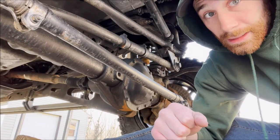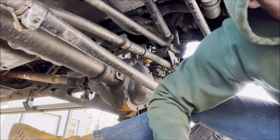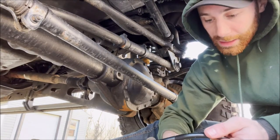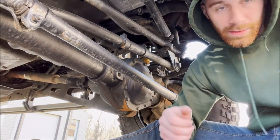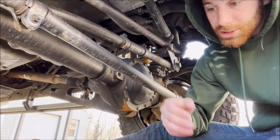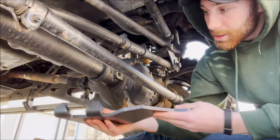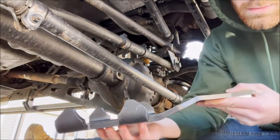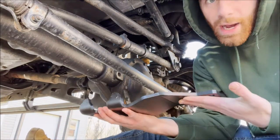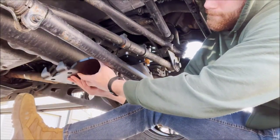We're under the truck on the passenger side wheel. I'm going to put everything on loosely at first and then tighten everything up. On the passenger side of the axle, you're going to put this piece with these little points sticking up. Where it curves is where the axle is going to sit in, and it should come up and sit above your tie rod.